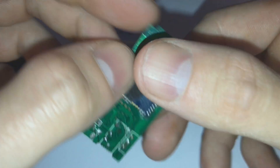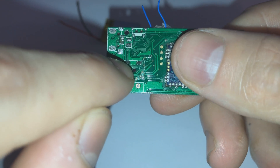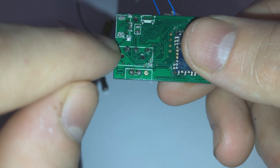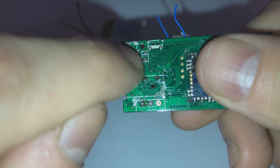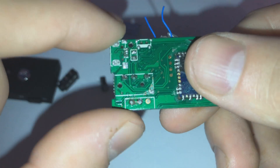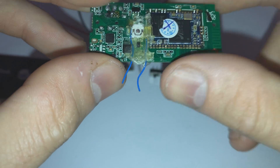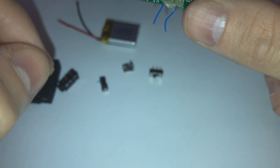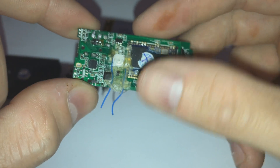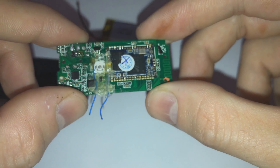Once it's stripped down, you have three contacts here for the headphone jack and two here which are for the power. I will show a picture of how it looks once those are soldered in. What I will do is make a connector here and another connector on the switch I'll be using, so I can plug it on and off for disassembly purposes.